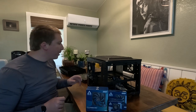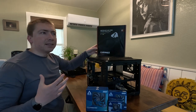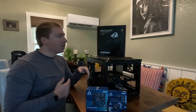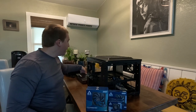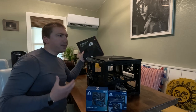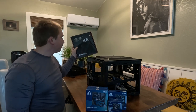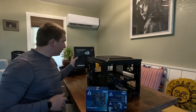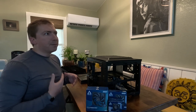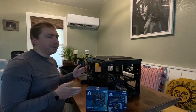The 200mm Noctua fan will help accelerate that process and as a consequence will pull air in naturally through all the ports where the case fans are sitting. If I get it right, the 200mm fan might move enough air so that only the CPU and GPU fans need to turn, with case fans only spinning up under heavy load - which should keep the system quiet, preserve a little bit of power, and make sure these fans don't wear out as quickly. If I can get the entire case to run on just the Noctua and CPU/GPU fans, I would consider it a massive success, especially for audio recording work where I don't want fan noise contaminating my audio.